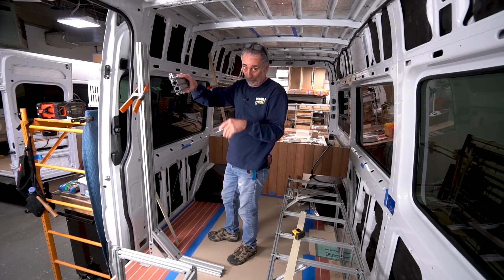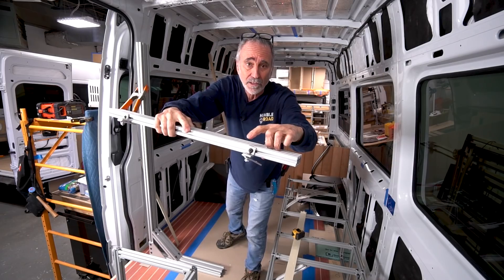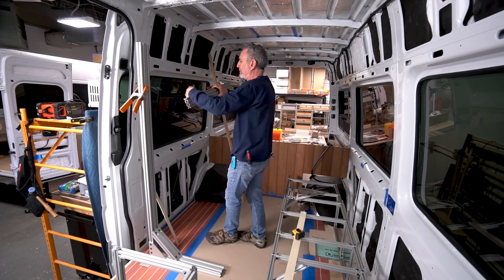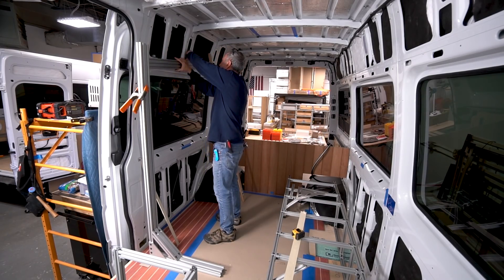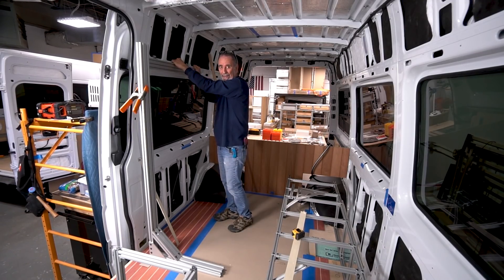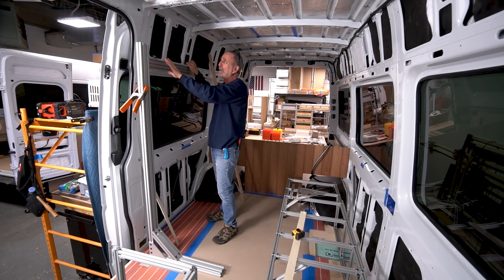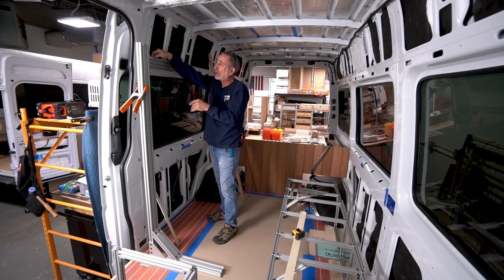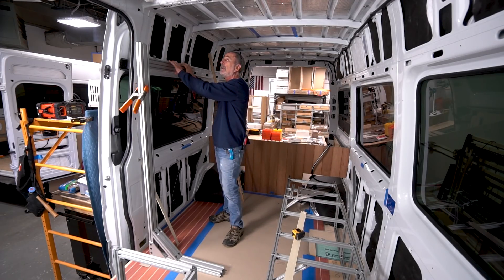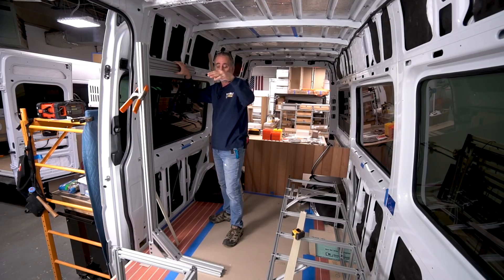Here's what I do. I start with my back plate — this is the basis for the cabinet. It's comprised of a couple of 80-20 elbows with a little one-inch plate screwed in the back. I hang that plate over this lip — they're in all the vans. When I get everything where I want it, I tighten down the top screw and it pinches. That back plate in the elbow pinches against the lip and that baby's in. The design allows it to rock so I can arrive at parallel.